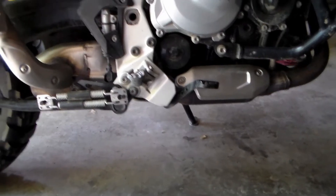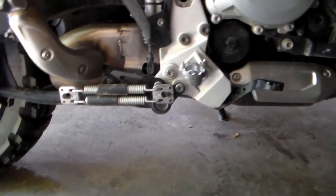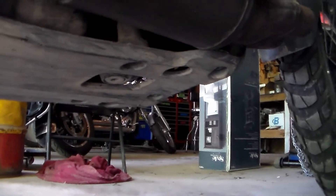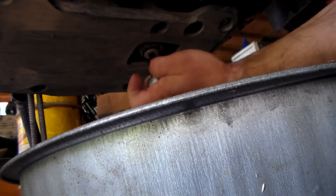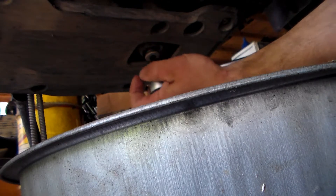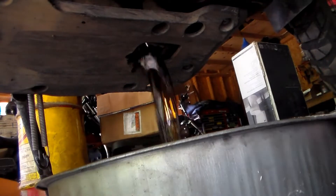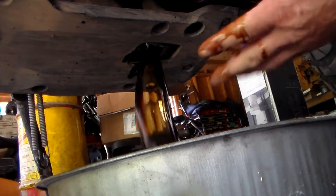You can do this with the bike on the single stand or on the double stand, whichever you prefer. Get yourself a pan that fits underneath there. Right under here, you're going to see your drain plug right in the middle of the skid plate. Get yourself a T50 Torx socket and go ahead and remove that primary plug. Make sure you drove the bike a little bit and get this oil warmed up — that helps drain more of the oil out.